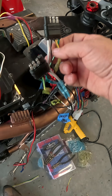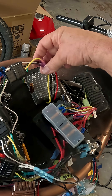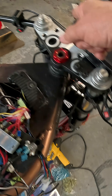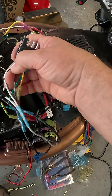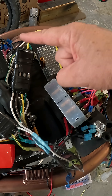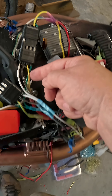These are part of the wiring harness on the bike; the opposite side is going to stay on the buck converter. The white wire is the 96 volts coming out of my key switch, so this is hot when the key is on — I want that to be the protected black one. When it plugs in, it takes the 96 volts into the buck converter and brings the 12 volts out going to the yellow one.